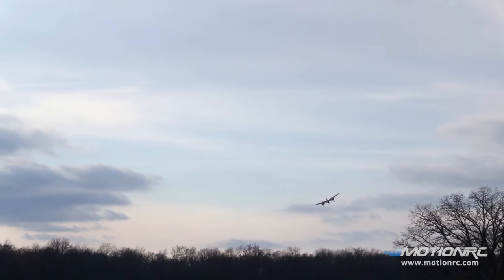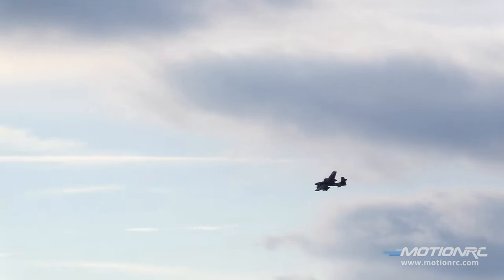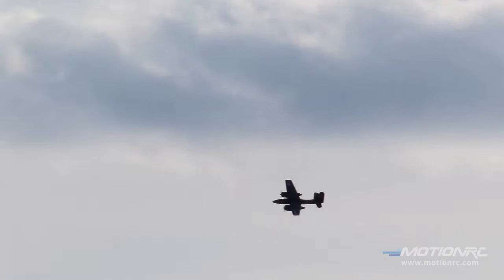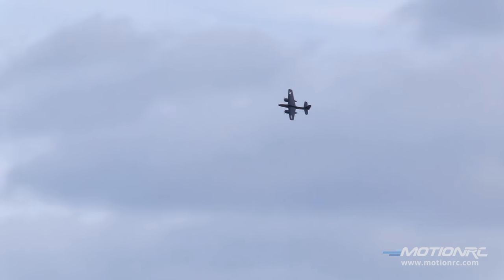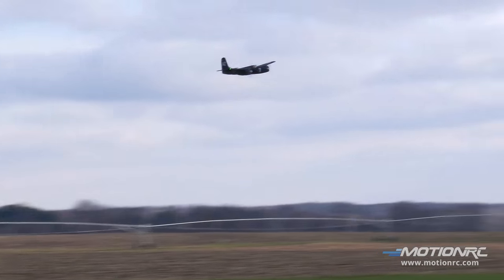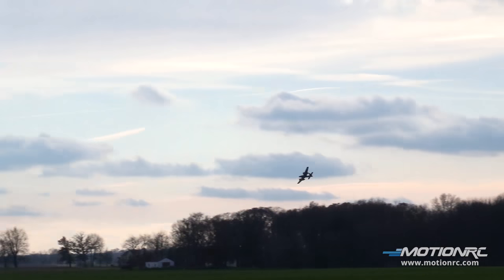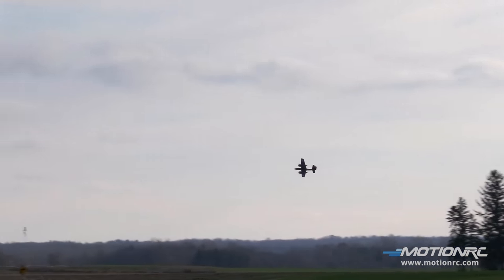I'm not messing around — we got a nice wind today. Go ahead and drop these, go ahead and put the gear up. I'm going to ring it out. I've been flying it on 3000s. We've shot some video with our two paired 3000s and photos. I've also flown it with a pair of 2500s. This is my first go with the 4000s, and I CG'd it in the same place. It's doing really good.